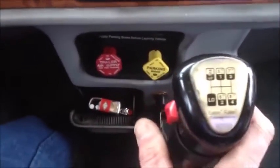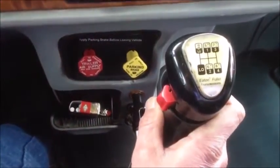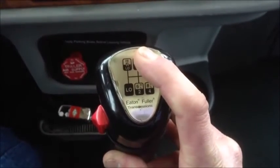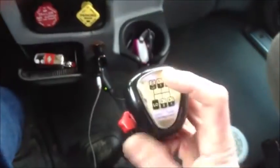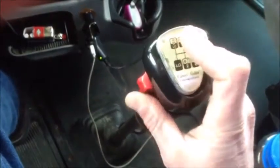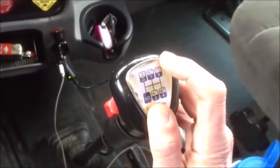Now we're in five high. We're accelerating, winding out in five high. As soon as you push down on the gas again, pull this back — remember, we're pre-selecting our range. So now we're going to go for sixth gear. We want to go into six low, so we've pulled back on that and pre-selected our range. Now as soon as we go into six low, go ahead and push that forward because our next gear is going to be six high. We've wound out in six low — just take your foot off the gas and it's going to shift for you when you step back on the gas. Now you're in six high.